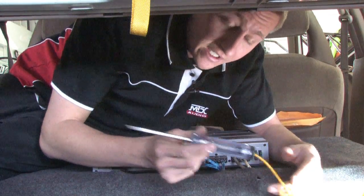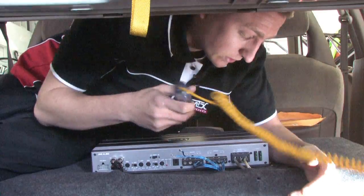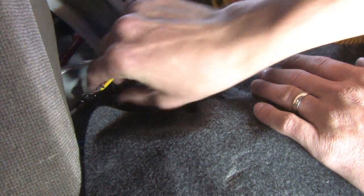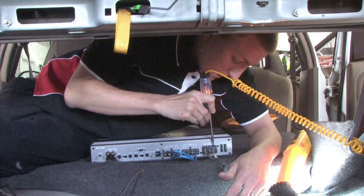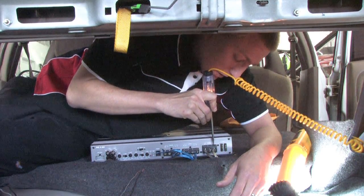By using your standard 12 volt test light, anything you can pick up at your auto parts store. So after finding a good grounding spot for your test light, you would first want to test your constant power. If you get a light, that means your constant power is good.